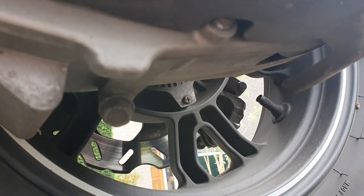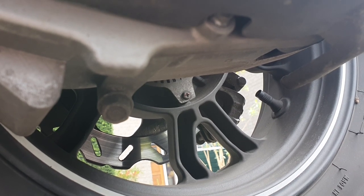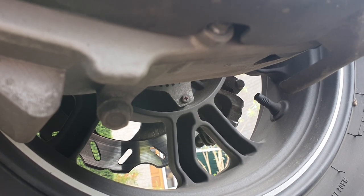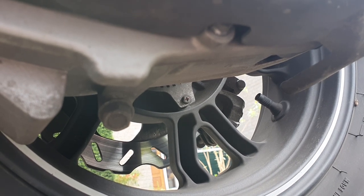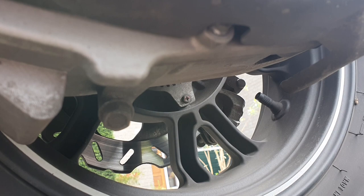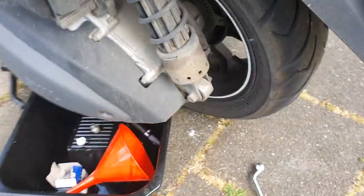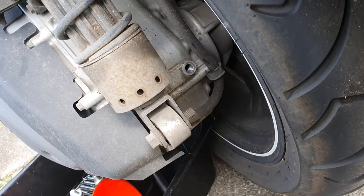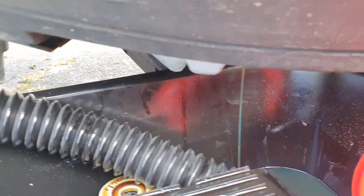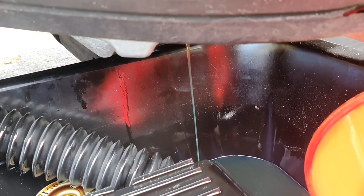Finally — this is the transmission oil bolt. We will unscrew it. The transmission oil is very, very thick and you need 300 milliliters per change. We'll loosen that bolt, collect the oil, then put new oil in. It is a very lengthy procedure because the oil is so thick — it takes some time to get in and out. Both the upper and lower bolts have been taken out — they're both size 14 — and this is the transmission oil slowly getting out.